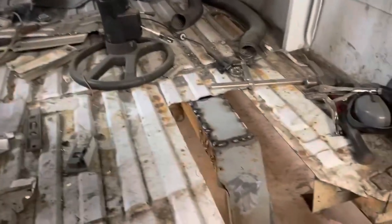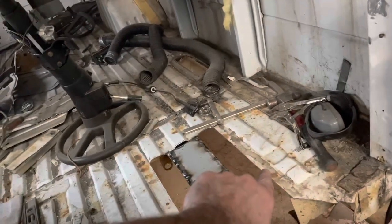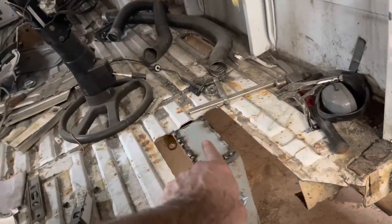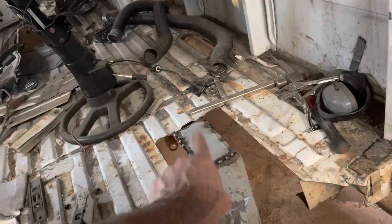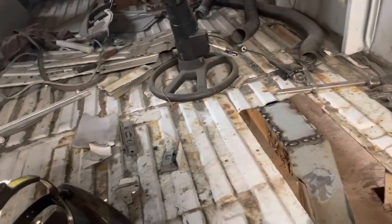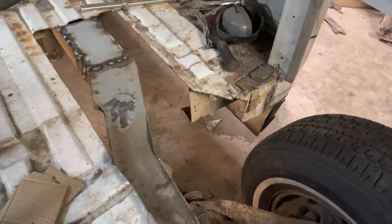All right, so not the prettiest, but I've got 9 plug welds on that side, 9 plug welds on that side, 3 inside down through the bottom of the frame, got it welded inside the frame, going up back there, and got a plate on it. So not the prettiest, but it ain't going anywhere. And the deck stands out, so we are free rolling.